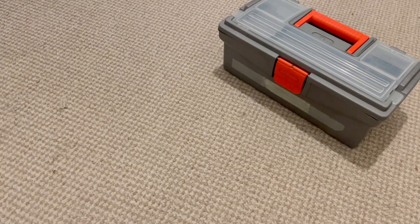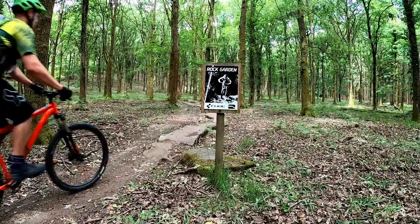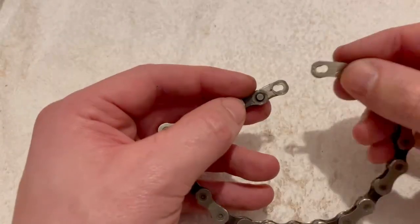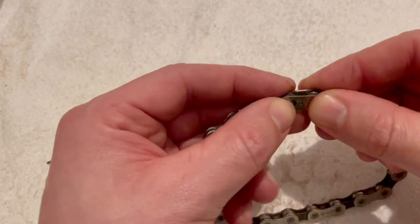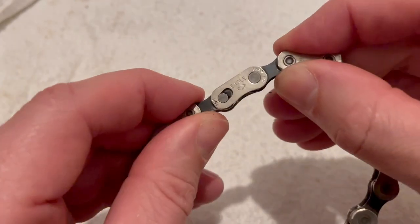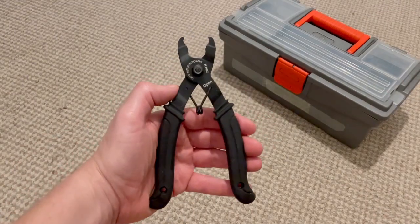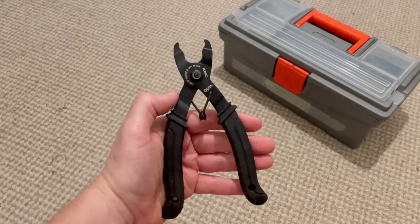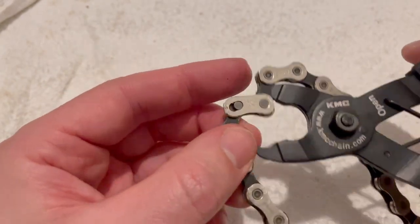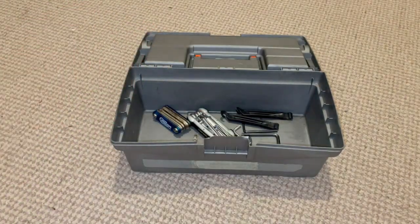The last toolbox must-have is a bit of a two-parter. The first is a set of quick links. For anyone who's ever broken a chain while out riding, you know that these little links are a trailside godsend. They can help you put your chain back together in a matter of seconds. They're also really useful for taking the chain apart without having to push the pins out. The tricky part about quick links is getting them undone, because this involves awkwardly pushing two of the links together. For this I use the second part, which is a quick link tool. This simple tool is something that can stay in your toolbox until the time comes, but definitely makes the job a whole lot easier.